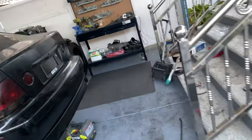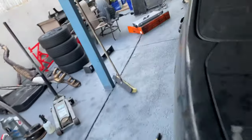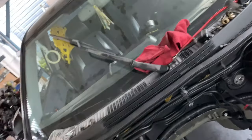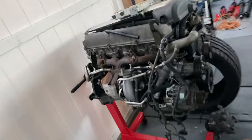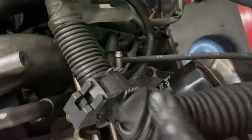Next up — fuel hanger. The IS-300 obviously runs a 2JZ-GE, meaning non-turbo, naturally aspirated, which means you're going to need a fuel hanger or you're going to need to run a return line from the 1J to your fuel pump. The return line on the 1J — I believe it's right here — this is the fuel return line. This goes back from your motor to your fuel pump. The reason it has this is because this is a turbo.